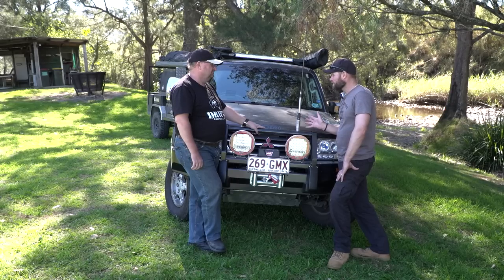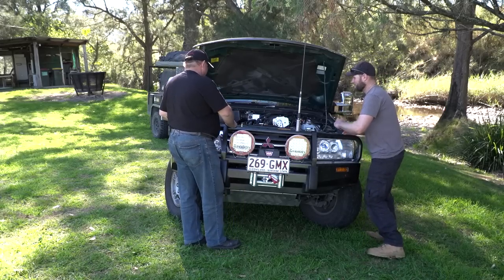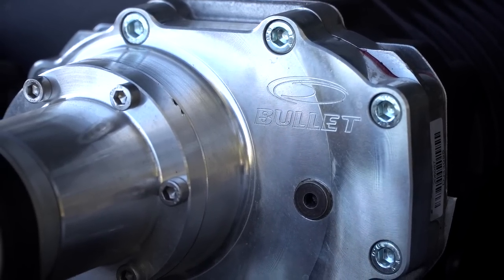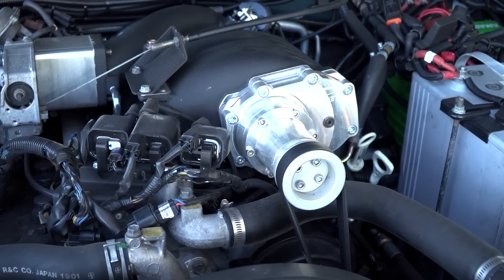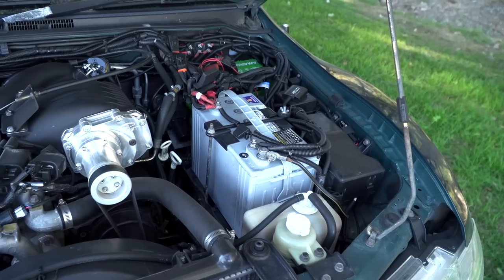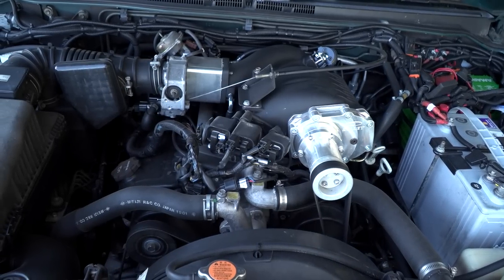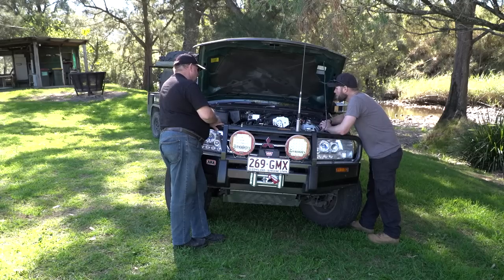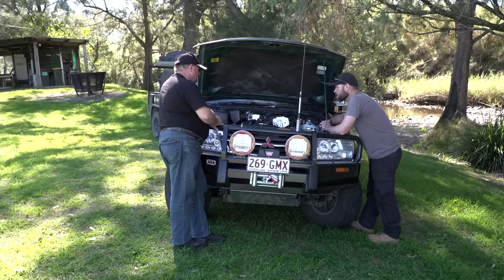Now to the power plant — and there's a supercharger. The supercharger is the key but there's lots of things in here. There it is — a Bullet positive displacement supercharger, 8 PSI. All stock internals still run. With a supercharger you get a constant 8 PSI — it comes in from 1,000 RPM, so you've got extra torque from down low right through the whole power band. It's a flat power band, which is what you want when towing — unlike a turbo or traditional centrifugal supercharger that builds boost with RPM.